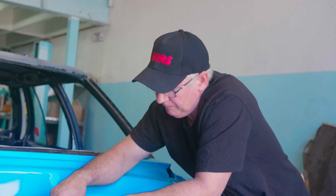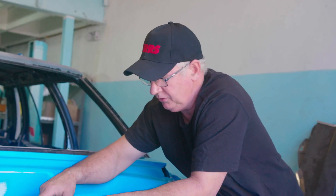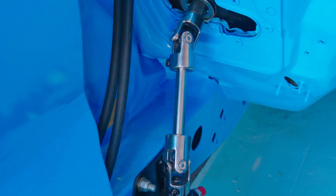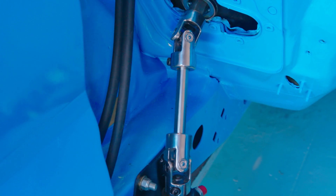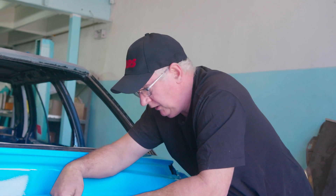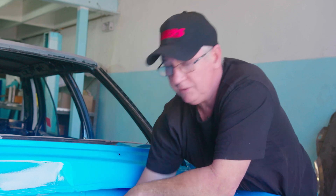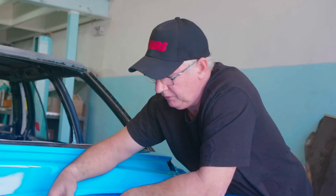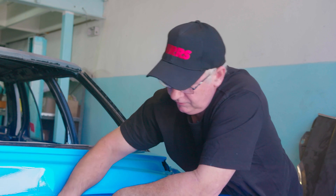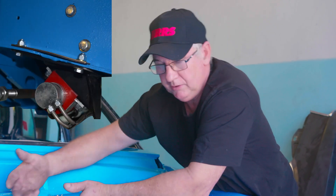The other part we've just been developing is our own manufactured design of universal joints. These are now forged stainless, load rated to 230 Newton metres — they're a beautiful piece. It also uses factory inner tie rod ends, which makes it very easy for serviceability. The mounting method is via two clamps to our adapters, which again makes it very easy to drop the rack in and out.